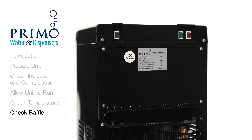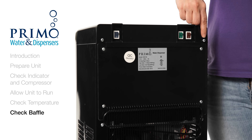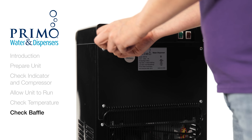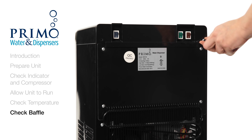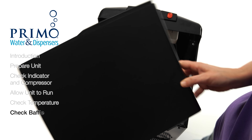We're going to need to remove your dispenser's top cover in order to access the reservoir. Turn your dispenser around so you can get to it from the back and remove the two Phillips head screws as shown. Lift the rear of the cover up and pull it towards you until it's out of the way. You can let the cover hang.